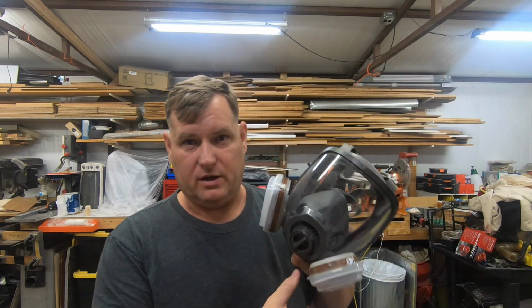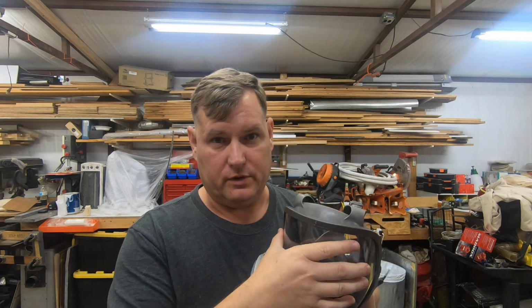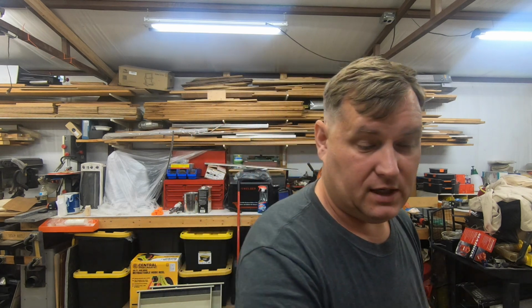So you want to make sure you've got really good ventilation, and you've got, at minimum, some kind of mask, something of this type. And I say with a face mask too, that covers your eyes. The reason for that is that this is not only stuff that you breathe in, this stuff, and the same with the urethane paints and anything like that, will actually get in through your eyes too, because it goes after mucous membranes and moisture and that kind of stuff.